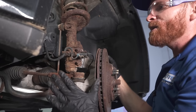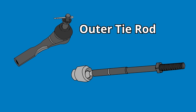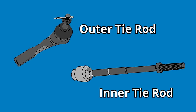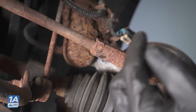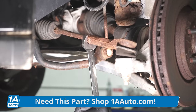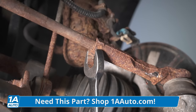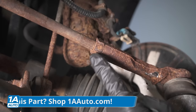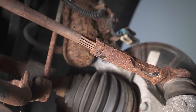Let's go with the assumption that you went ahead and diagnosed your front end issue. Maybe it was an issue with the outer tie rod end or even the inner tie rod end. Either way, you're going to have to make your way right here to the jam nut. Issues you might find when dealing with the jam nut: you put a wrench on there, you try to turn it, and it feels as though it's stuck on there.